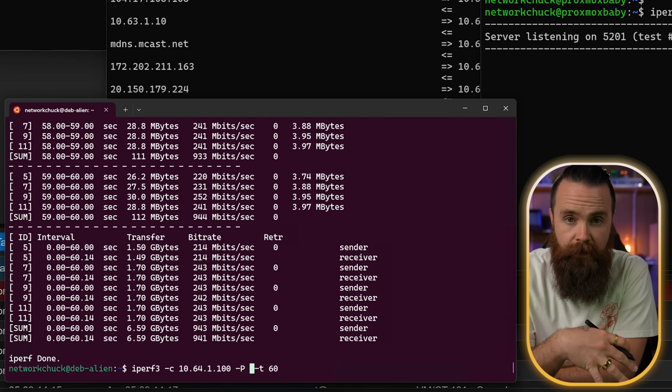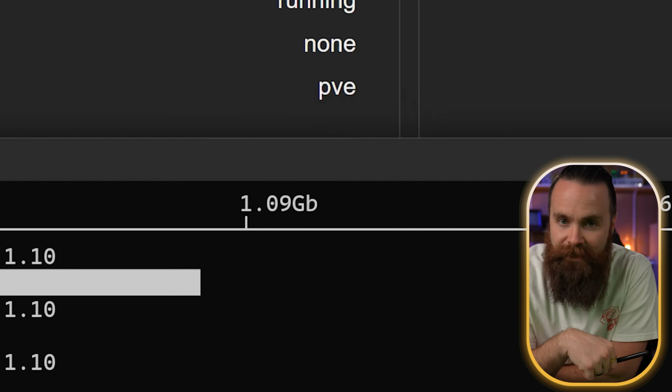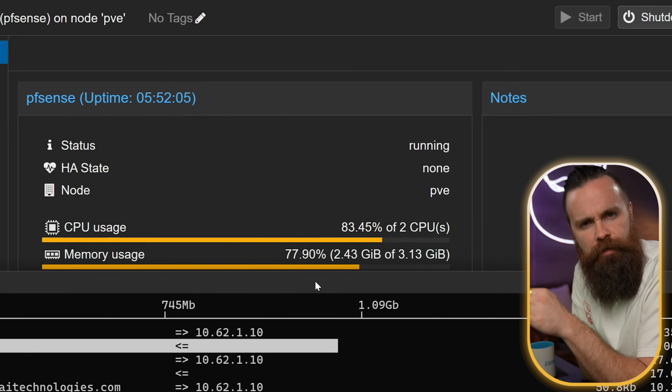I ran iPerf again, and unsurprisingly, we had more throughput, clocking in about 1.09 gigabits per second. And oddly enough, the CPU utilization was lower. Comment below why you think that is. Now it's time to test this with IDS and IPS.